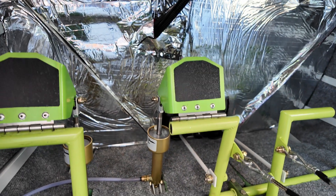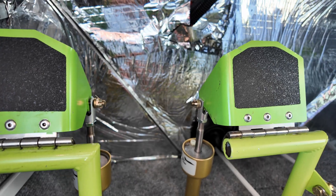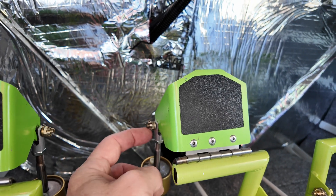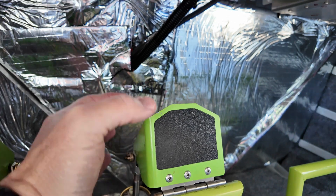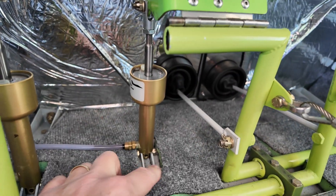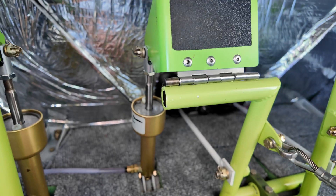I did lots and lots of research. Some people are saying the geometry of how the pedals are in the Zenith 750 line is not that great, and then I got the bigger tires. Some people say go double pucks on the brake system. What people are saying can fix this lack of braking force is to move the geometry of this master cylinder a little bit — take it off and put it in a little bit closer. Some people have actually put a bolt at another higher-up tube to get better leverage. If you do move it in a little closer, you really need to move this bracket down here forwards quite a bit, or your pedals won't reach and you won't have enough rudder authority.